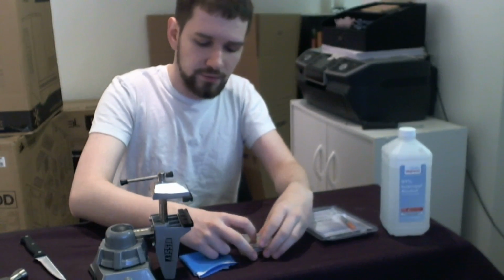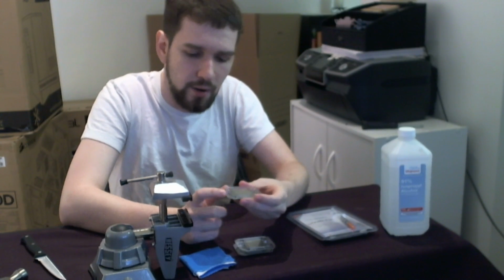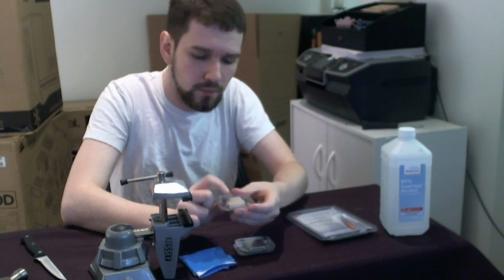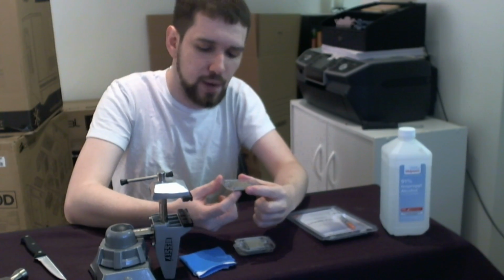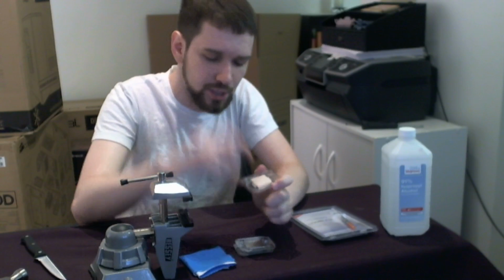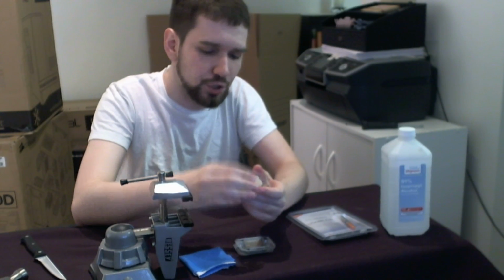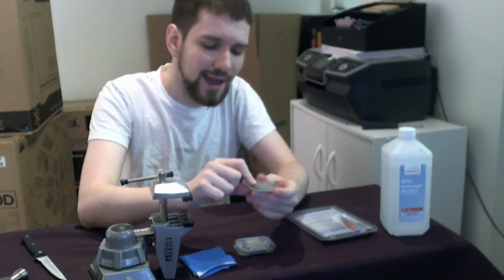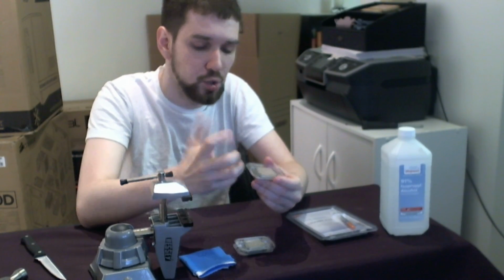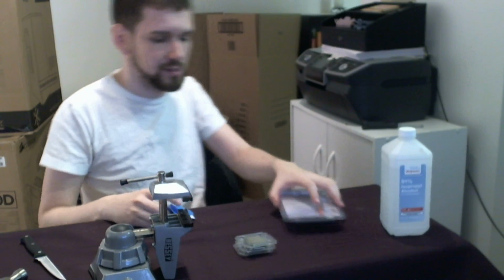Okay, so we've got our three chips. We understand that the three main parts that we're concerned with are the PCB, which is the printed circuit board, the green part that everything rests on, the IHS, which is this nickel-plated plate that goes on top of the chip. It's the thing that people see that they probably think is the CPU. And then underneath that IHS, the integrated heat spreader, is the computer die, which is where the actual architecture of your computer chip is housed inside.